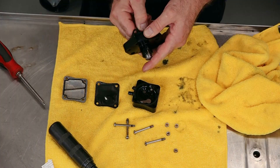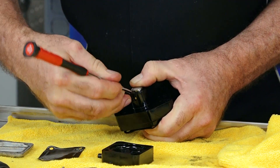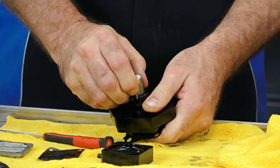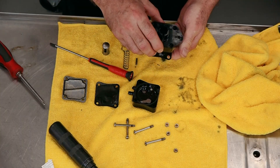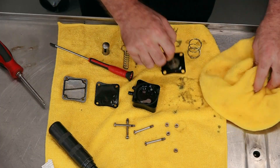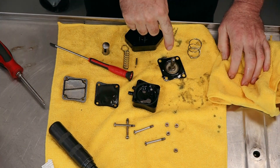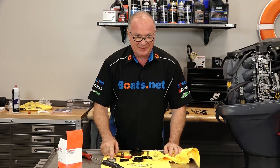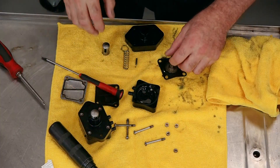That'll remove the diaphragm. You'll turn it roughly 90 degrees to where you can get to the pin, release some tension off of it, and scoot it out. Don't just release it, otherwise it's going to go flying. So if you were just going to rebuild yours on your own, I would have ended up having to buy the diaphragm, this housing, this diaphragm, and then that seal — and guess what? You're almost at the cost of the entire assembly. But that is how you take it apart at any rate.